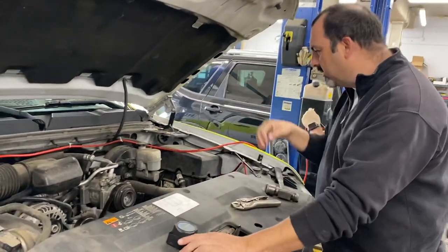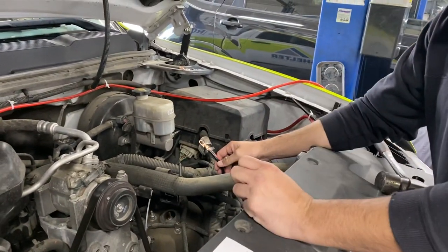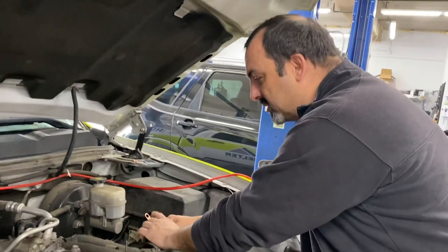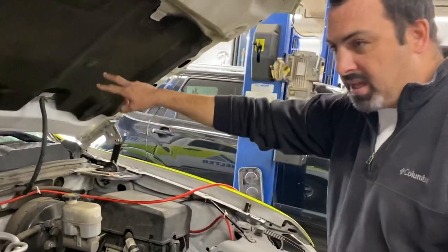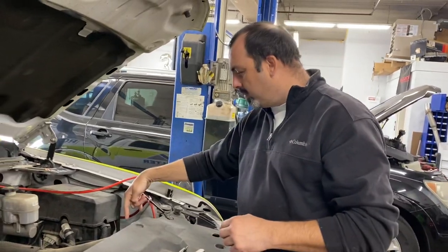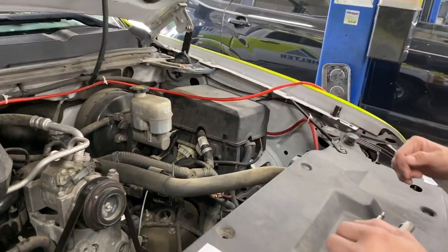The other thing we've done here is run these large cables. The reason is that the inverter takes a lot of energy to go from the front to the back. So we're producing a lot of voltage from the front to the back. We have both a ground and a positive wire that we've already run to that inverter in the back, and we're going to ground that. Then we're going to have our main battery here, put a charge line right here, and also put a ground line from the secondary battery once we're done.